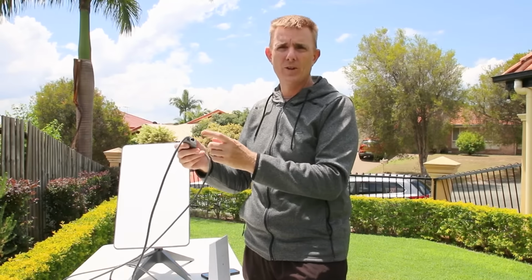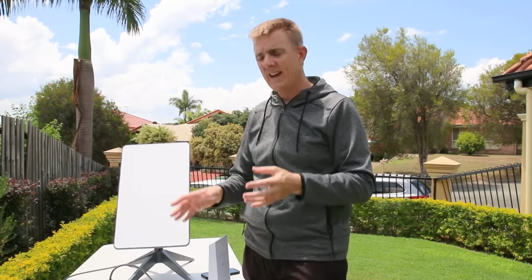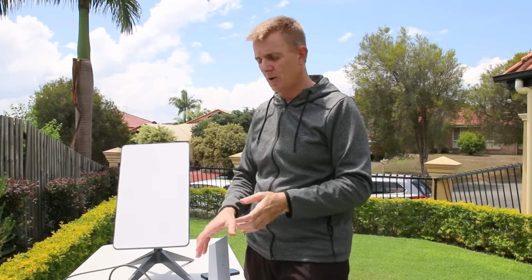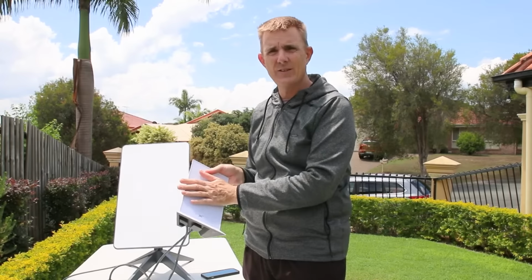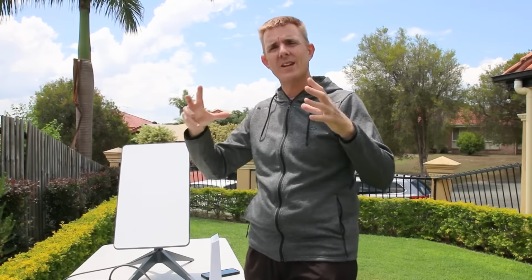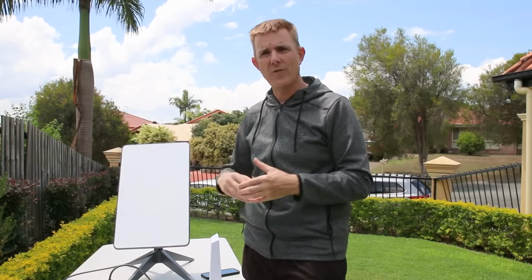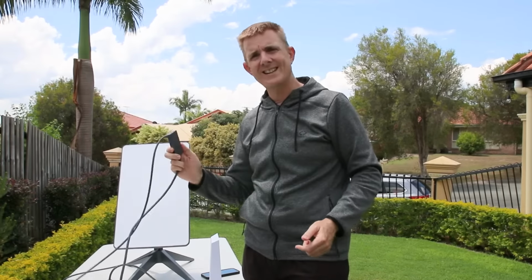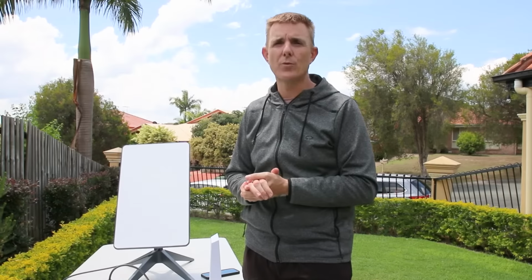But what you probably really want to do is plug this into a new router, all right, and build your network from there. Use the app like I've shown you to change this into bypass mode. You're still going to need to leave this on, but it's not going to be actually doing anything. So to use any of the other features we're going to show you shortly about how to extend your Wi-Fi across your property, you really need this Ethernet adapter, and really probably need a router.